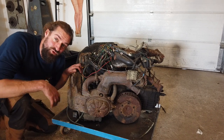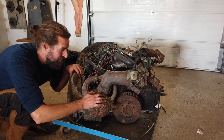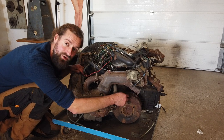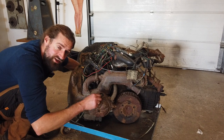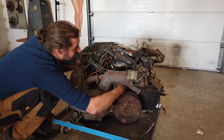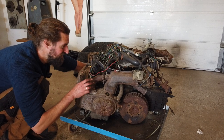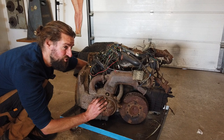If you don't know these engines, some of you might never have seen one or know anything about Citroëns, but take a look at this clever design. It's got some features that are also used by Alfa Romeo and I think even Maserati. Inboard brake drums — later on these become real discs and calipers — all the way in at the gearbox side, not at the wheel side. Then you have a two-cylinder boxer engine, air-cooled, doing like that — one on each side — and then the gearbox and the starter on top. It's just a really clever, light, and quite efficient package. The maximum output is around 32 horsepower on these engines; I think this is a 28 or something. It's around that mark — pretty impressive from a 602cc engine.